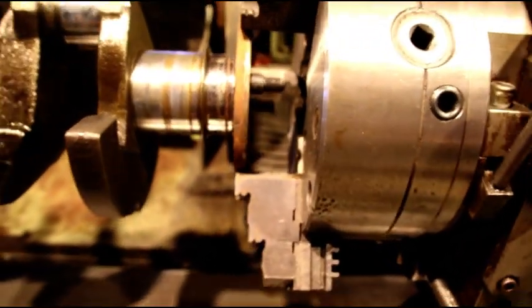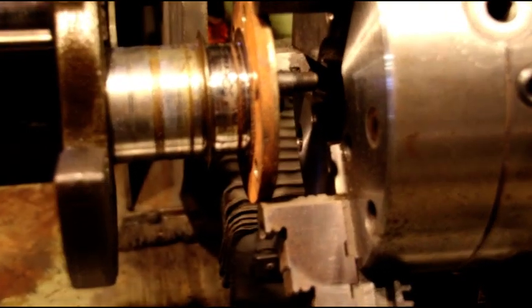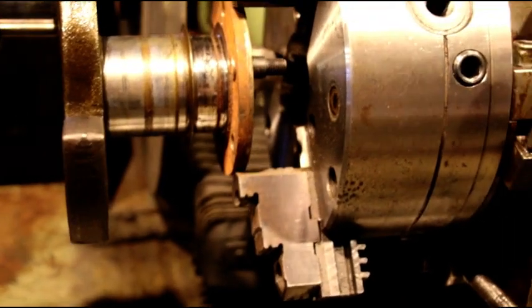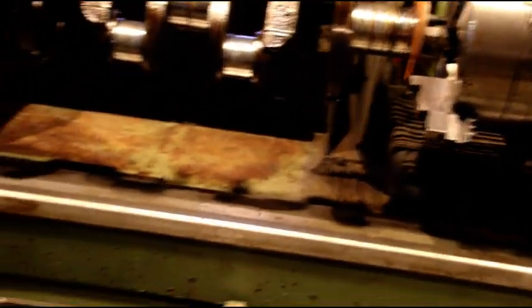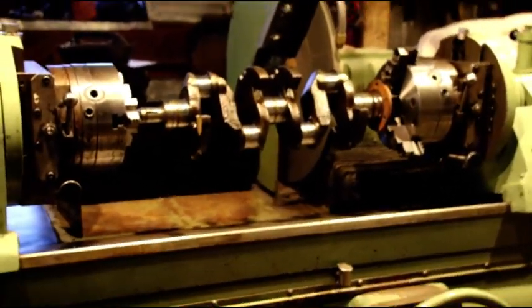So, you know, I'll show you the grinding when it happens, but I'm kind of going backwards on this crank. I thought I was going to be able to sand all that out with some 400, but just not the case. But I'll pull that out, get it welded, and then we'll get back to grinding on that one. But, you know, sometimes these things happen. But I've got pretty good assortment of belts, and we'll get that one ground and polished up real nice.